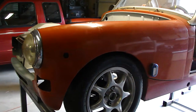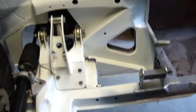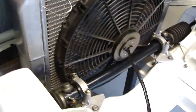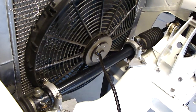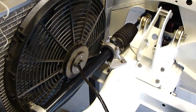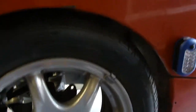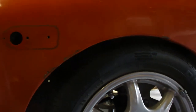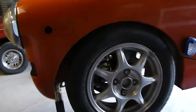That's everything we need to tell you right now about this awesome little build. Sheet metal is coming — that's all the sheet metal in the engine compartment — but again you need the engine in or you're going to put sheet metal where you shouldn't. The rack and pinion is out of an earlier MG Midget. It's the better of the two choices — much bigger, sturdier, and rebuildable version of what's in them now. This is a '77 so it didn't come with that. This is the ride height it's going to have — it's got struts in there to hold it at ride height.